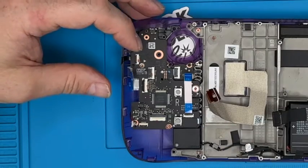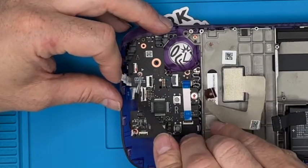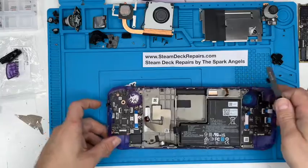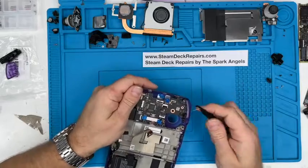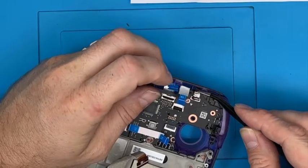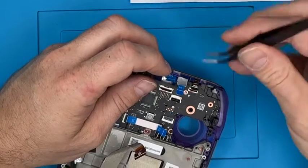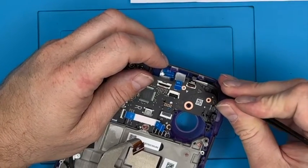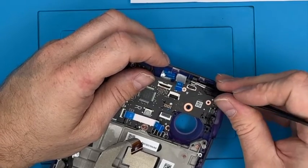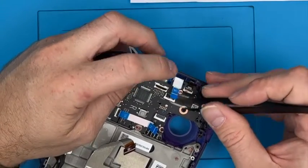So let's put these ribbon cables in. We use our tweezers. So we flick the clasps up. And then, it's hard to do it, I'm trying to do it on camera, just turn it around. I wish Apple would use these little tangs, they make it useful. That one wiggles in. Oh, that one went in nicer than the other side, didn't it? So give it a wiggle. White line in line with the back of that connector, so you know it got in place.